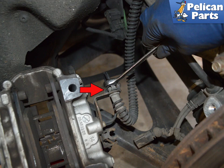To separate the brake line, the factory line sits in two grooves in a mount that corresponds with two notches in the line. This keeps the line from turning while you unscrew the nut on the hard line. You want to use the right tool for the job. That tool is an 11mm flared nut wrench that is designed to grasp the nut on 5 sides. The nuts on the hard line are easy to strip. Do yourself a favor and use the right tool.